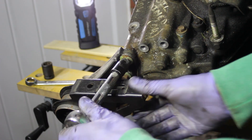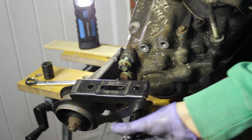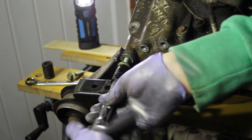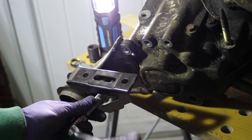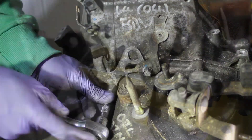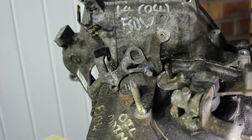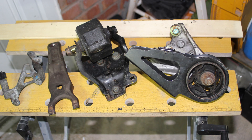We're going to do this other bracket - undo the bolts off the back, I think it's three. Just note: don't do it on the workbench like I have because the twisting forces ended up cracking my workbench. There's a mount either side and a little piece of bracketry to take off, and a bracket up towards the top of the gearbox. Interestingly this gearbox has scrapyard markings on it, so this is probably the third or fourth gearbox this Honda Jazz has had.